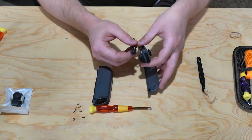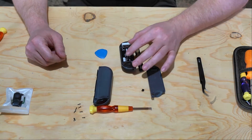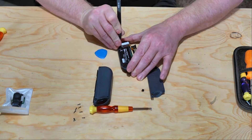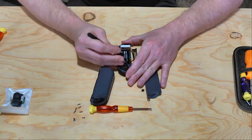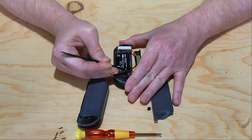This just makes it a little easier when you go to pull the joystick off. The next step is to remove the battery. They don't put a lot of glue on them so they're not real hard to pull up. Try not to puncture the battery — lithium ion makes fireworks.